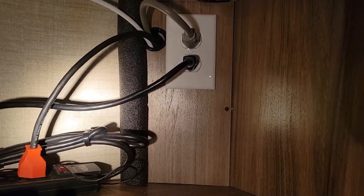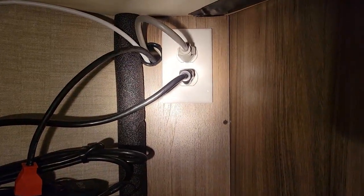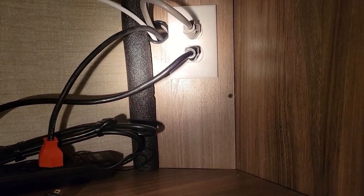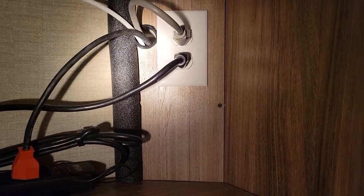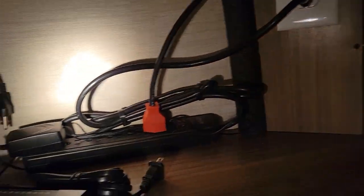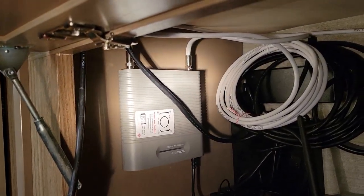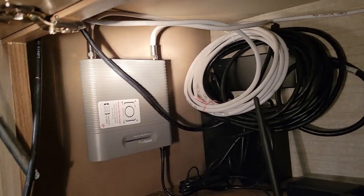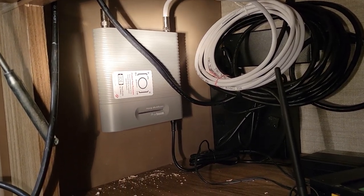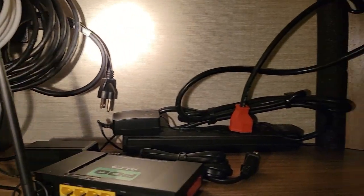Got above the microwave back together. The top gray cord is the microwave, the bottom black cord goes to the power strip, the orange and black goes down to the relay system behind the refrigerator so I can run the refrigerator on inverter or gas or electric. That is our Wi-Fi booster right there. And that is our mounted, all hooked up, input and output WeBoost cell phone booster. Now I've got to finish fishing the wire behind the refrigerator under the sink.